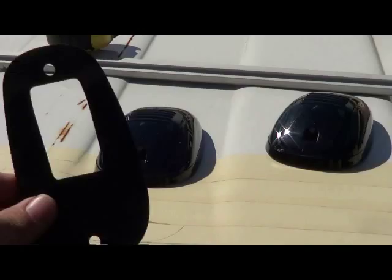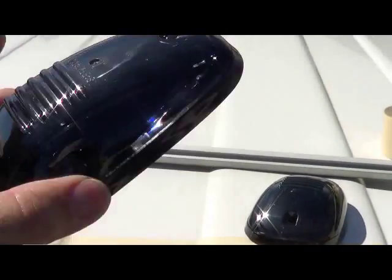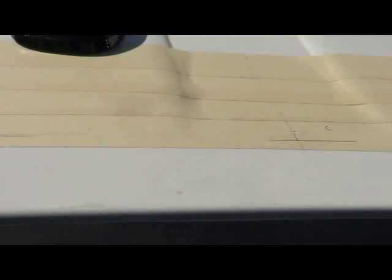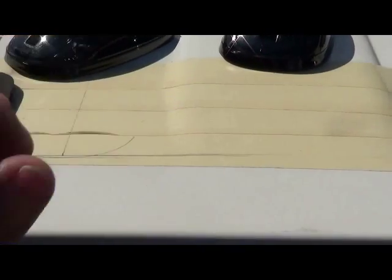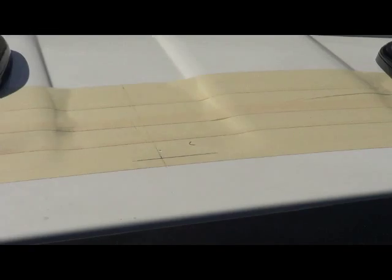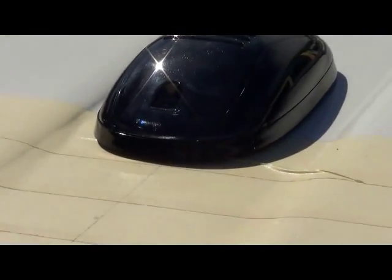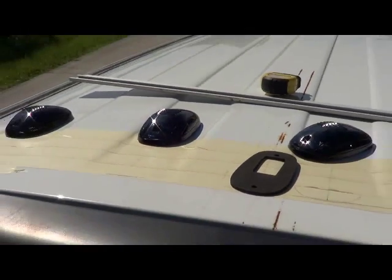You want them pretty much straight forward and back. I tried to figure out where I could run a 90 off of here and use my square. Off of this line that I ran across here, I measured a 90 back this way so that I could get a line to mount the lights on. That's all pretty simple. They mount with two screw holes — one front, one rear — but you've got to have a hole in the center for the wire to come out and go through the roof. So you end up with three holes: two mounting holes and a hole for the wire. I bought some rubber grommets where you drill the hole and pop the grommet in — that keeps the wire from getting cut on the edges. I think I've got to drill a three-eighths hole for those. The hardest part is laying it out; drilling the holes and mounting them is easy. You've just got to commit to your position and make sure you've measured it a bunch of times so that you've got them in line and spaced out the way you actually want them on the roof.